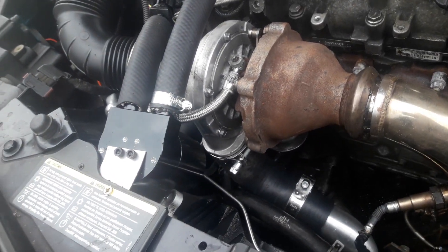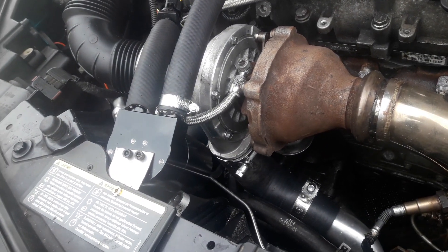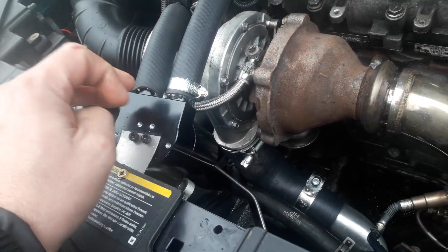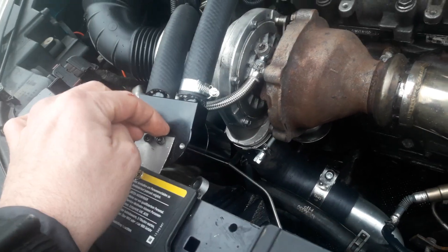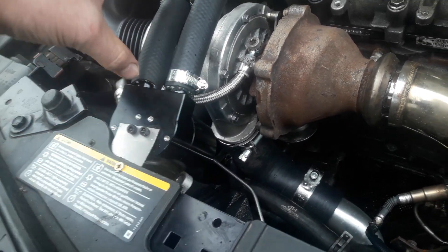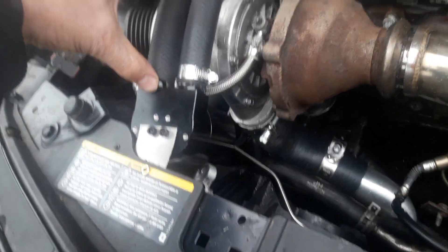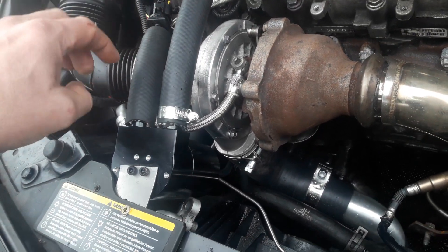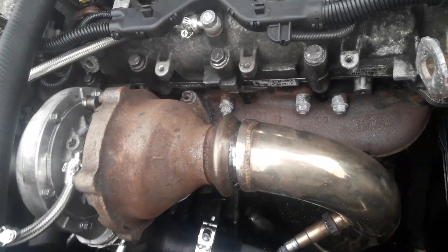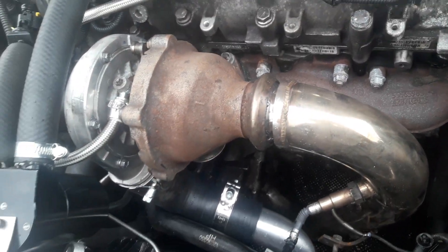It does require mapping to make maximum use of the power available. Just to be on the safe side, I've also fitted an additional oil catch can, which as you can see is here. This bracket needs to be correctly positioned and painted, and there's another section of pipe to go in and the jubilee clips to be fitted — it's all snagging list type stuff.